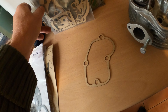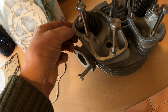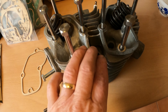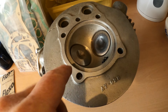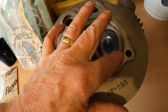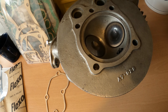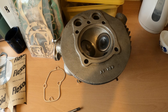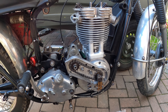What I'm going to do is go back to my best friend flexoid and make some individual gaskets to fit perfectly. I'm also going to grind the bottom of the cylinder and try to bring it down as much as possible so it mates on the spigot with as little gap as possible. I do have a very thin copper gasket I've made to take up that small space, but I might try to grind them together first.